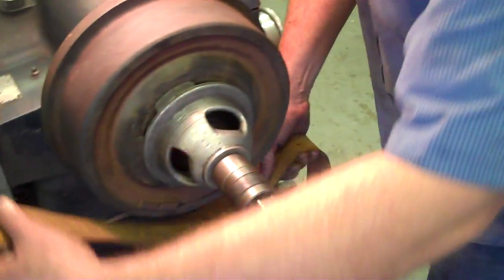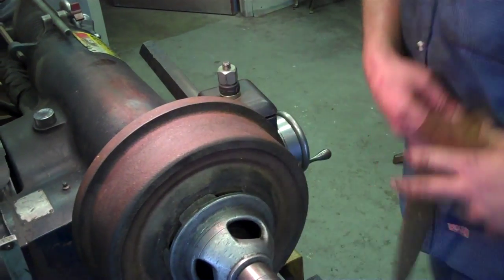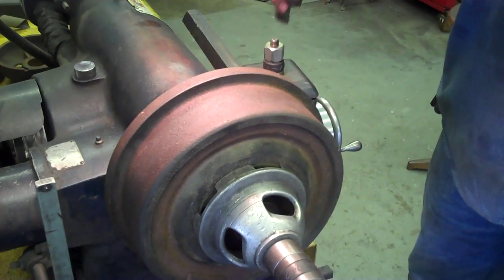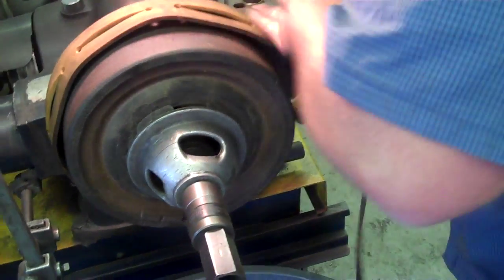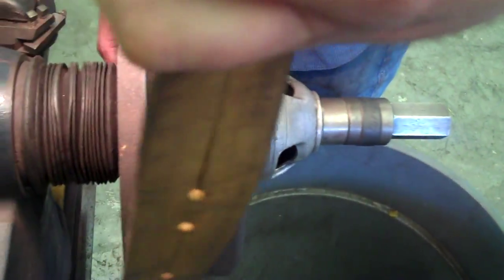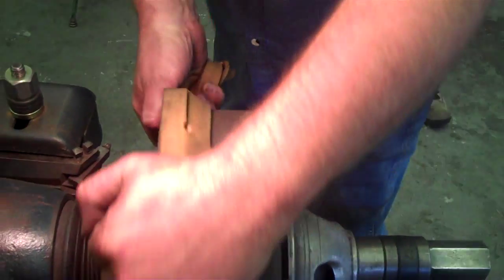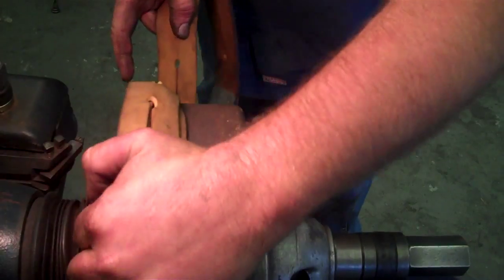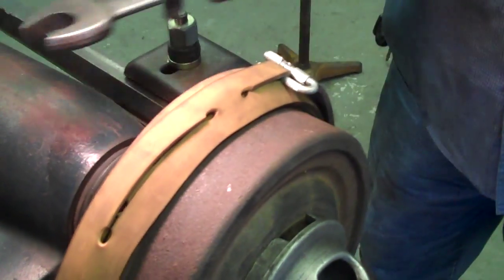Try not to put the belt on the floor or they get destroyed. This is the hardest part. If you don't pay attention, this will really fight you. You've got to get this belt really tight, otherwise when you machine it will sound like a bell. So get a lot of belt, get it right on the edge — you should show right here, right on the edge. That's where all the noise of a bell is made. I'm going to pull on both of these and then pinch it. Instead of wrapping the belt, I turn the drum — and as I'm turning, I'm pulling on the extra belt. Then just loop it in. Let's see how it sounds now — very different. We're good.